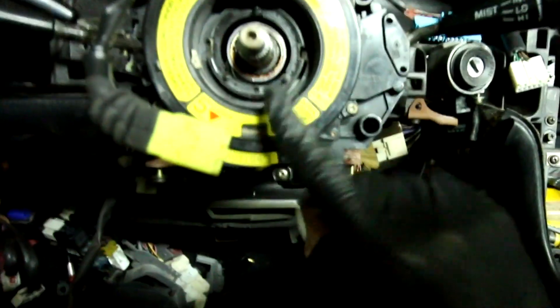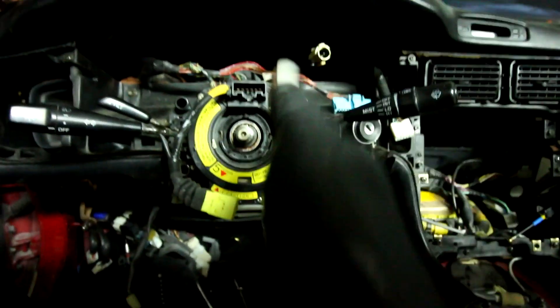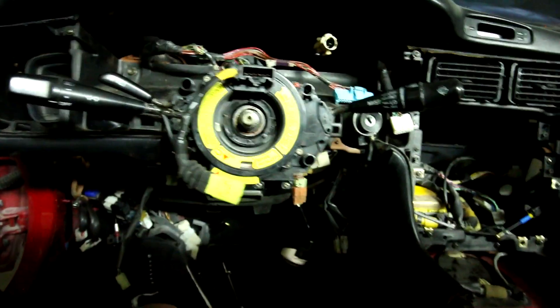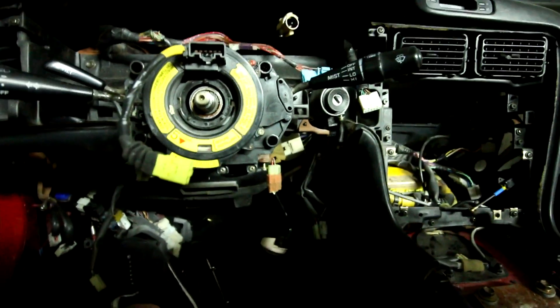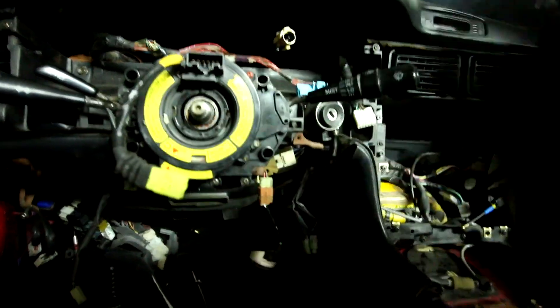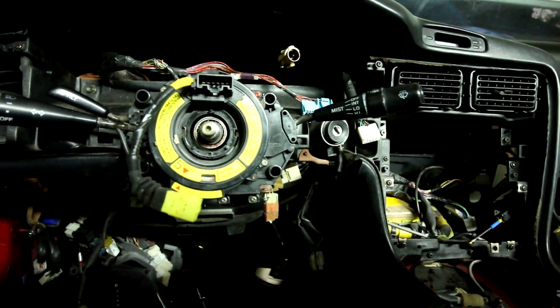I just smacked myself in the face really hard. At least I think I got these wiring issues sorted out. Tilt wheel, do you work? Tilt wheel works - holy crap, does it work. Now I'm going to put on the steering wheel. See how this steering wheel has a marker where it says turns 5, caution, with a little red arrow? Basically when I took the steering wheel off this car, I had the wheels positioned exactly straight with this lined up right in the center. My steering wheel was also positioned dead center, so when I go to put this back on, as long as these two red arrows are lined up, everything will be good to go. I have been taking this off and putting it back on as a whole assembly, so nothing has spun. If you put it on all wonky, your steering is not going to be correct. But I have it set dead straight.